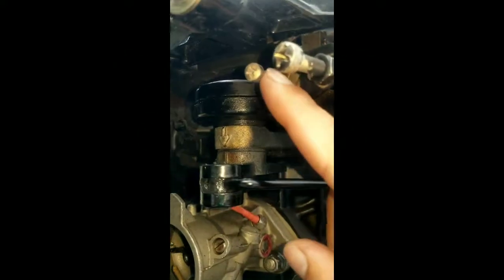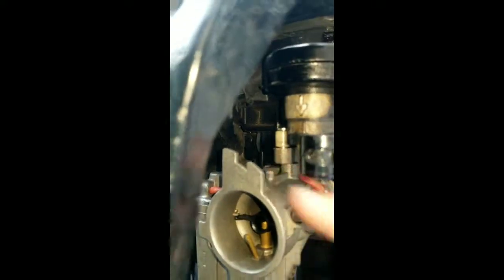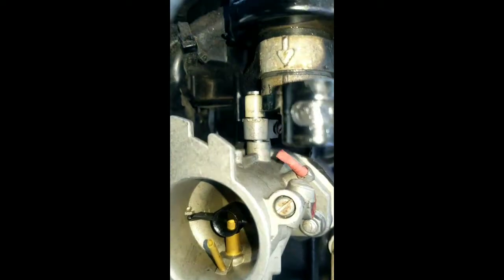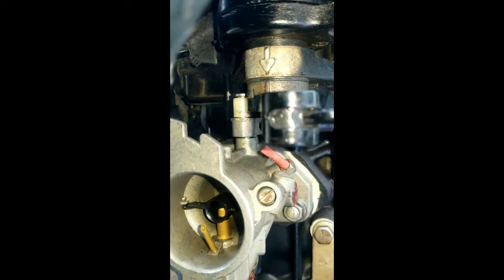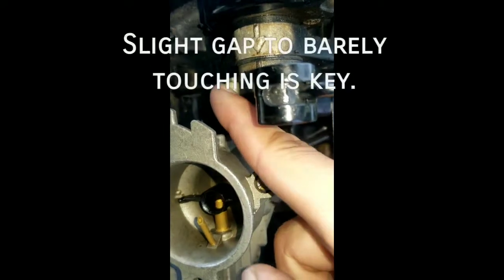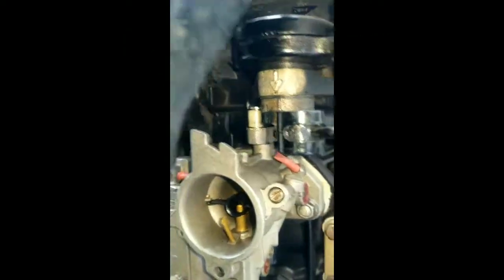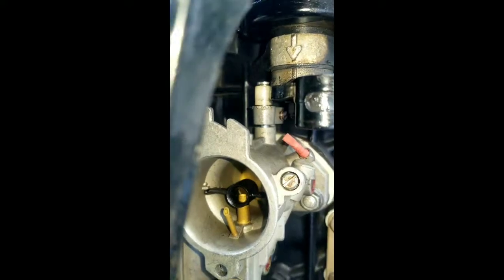The final screw is for your primary. This actually moves basically the whole arm and controls where it touches the carb cluster. When this thing is set at idle, these lines should line up — they'll give you a little bit of play when you do the final sync on the water. When I start to throttle, there's a slight gap between the throttle cam and the roller, like a millimeter or so. Essentially, that allots time for the timing to advance a couple degrees before the carbs start to crack open. That is critical to getting this engine to take off out of the water when you're trying to throttle.